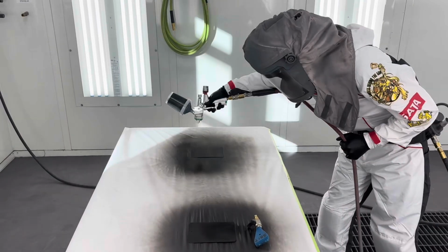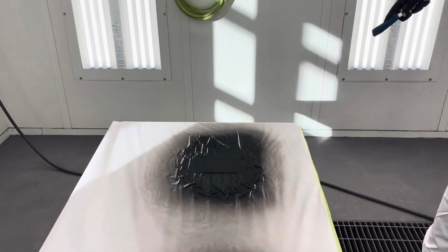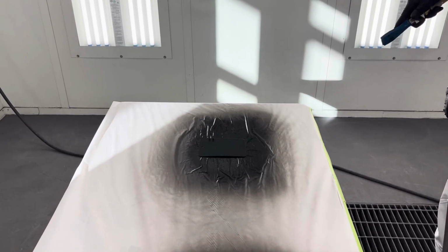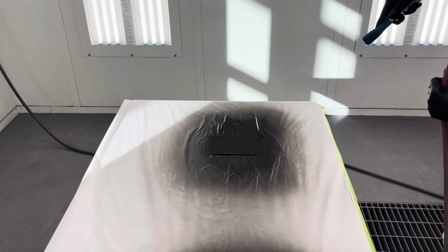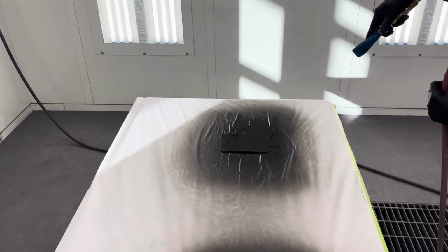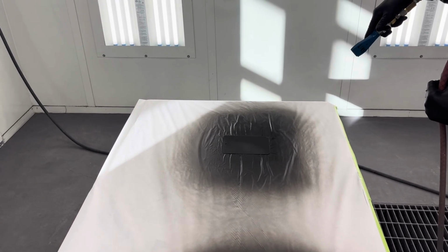This next video shows the same spray out card, which was painted with too much base coat. It was over applied. And then this also used the correct method for dehydration. So the only difference between these two videos is the over application of the base coat in this video. This one has also been sped up to twice its normal speed. And when this one was timed with a stopwatch, it was much slower because of the over application.